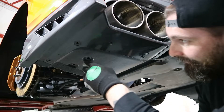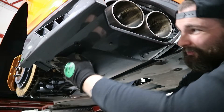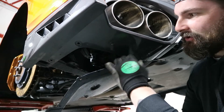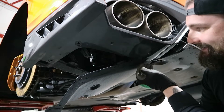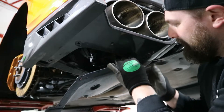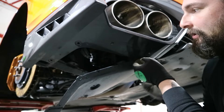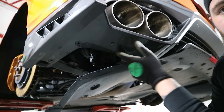This bit might seem a tad violent, but I've done this on two GTRs beforehand. You're looking to tilt these down just a touch — there is a good degree of flex in that. What you want to make sure you don't do is pull it too much or put too much stress on it and crack this, because this is plastic. It is part of the bumper and will be expensive to replace. Make sure you get to the point where that's the flex and you're not pushing too hard down on that. I'll change the camera angle to try and show you the bolts on the inside that I'm going to be going for.